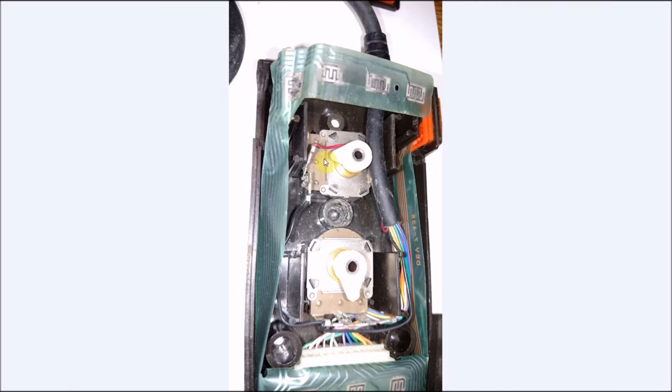So you can see here's another shot of it. Now on the wire harness, you can see there's a brown wire and a black wire. That's going to be used for your steering, your left and right on the new potentiometer, whether it's a paddle controller from a 2600 or the one part down below I got from Radio Shack listed. And then the upper potentiometer here is, again, the black wire is the ground, so that goes between these two, and it's going to be the red wire. Now, this red wire and black wire is going to go to a switch over here with the resistor, and that'll be our high-low gear.